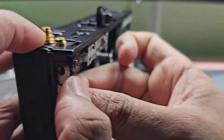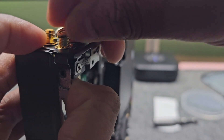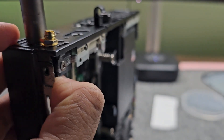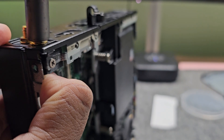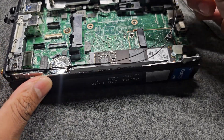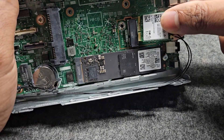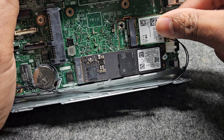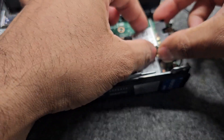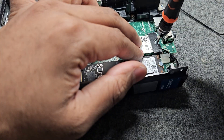Repeat the same process for the second SMA. Now be sure to make the nut tight — we used one of these, but you could use pliers. Now that we are done with the SMA, we are ready to plug the card onto the motherboard. Simply plug the card into the M.2 WLAN slot. Make sure that the black safety bracket is on. This will ensure that cables will not come away and cause a short circuit. Now screw it on and we are done with the installation.